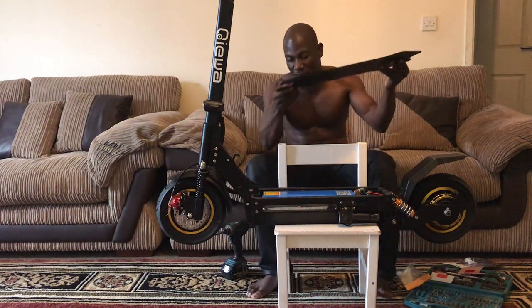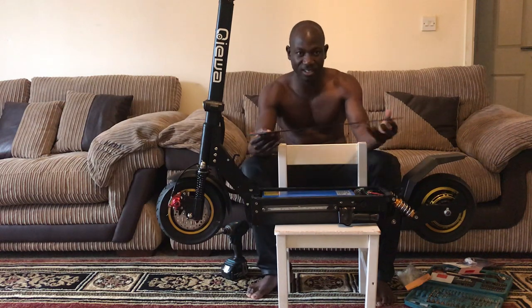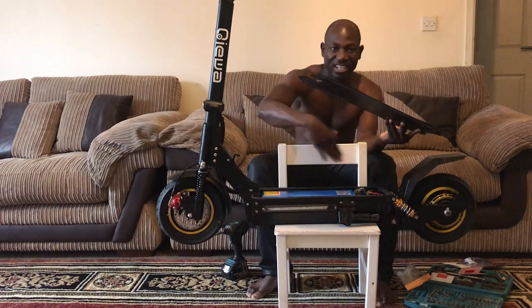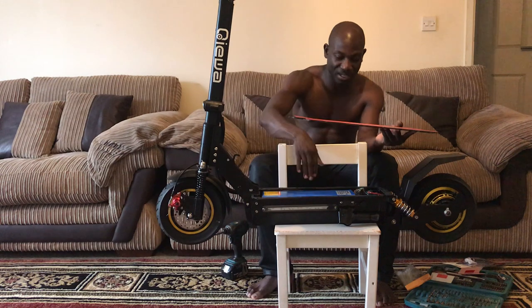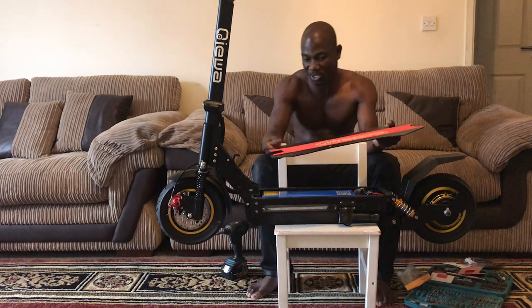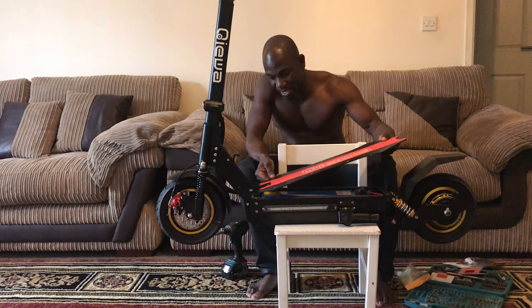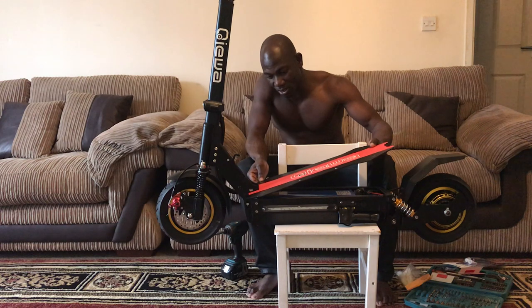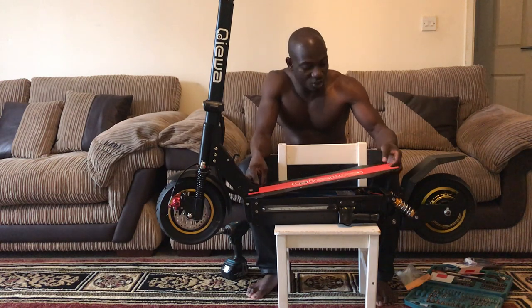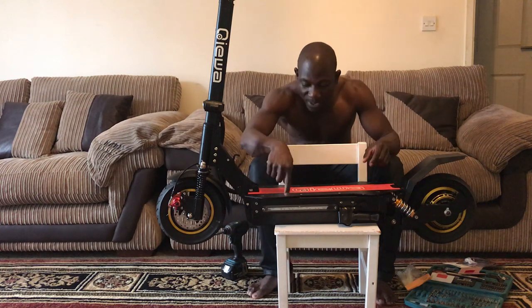And once you finish, all you have to do is just slide this one in. Don't put it like this and start dragging. You keep spreading the silicone without pressure, and by the time you apply pressure, you lose some of the silicone, which is going to make it not too watertight. So what you have to do is put this in first. Of course, when you get there, just drop it down nicely. Don't press it, drop it down nicely, because you have to line them up with the hole.